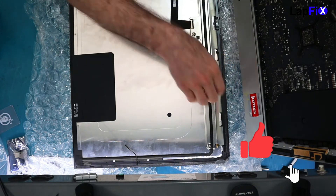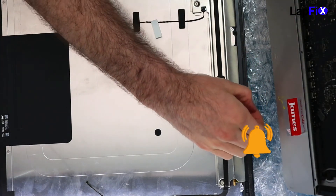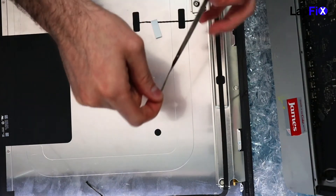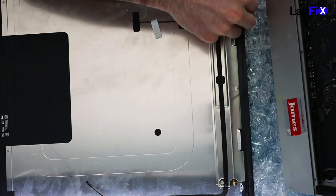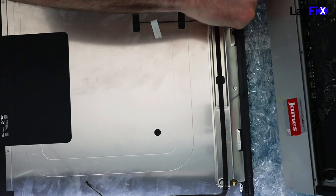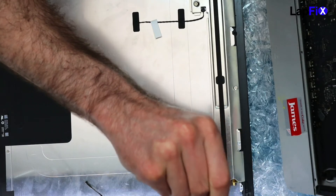While that's cloning, we also want to take off the tape around the edges of the screen because that's part of the adhesive too. You can just use your fingernail all the way across — it comes off pretty easy. This will stick to the screen, so when we put the new adhesive on you'd have the same problem. Nothing too difficult; just use your fingernail. This is the manufacturer's tape and it usually comes off cleanly.